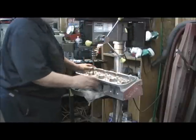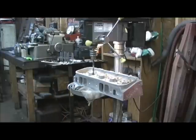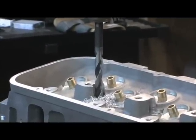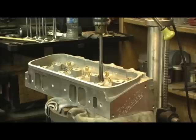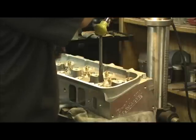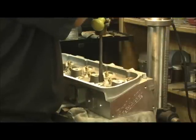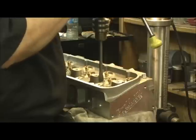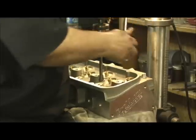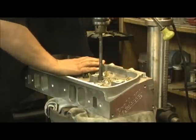Now I'm going to go ahead and drill the other hole, then come back with a core reamer and do it. I'll show you how good the fitment is, setting it up for the brass tube. Just a regular core drill — and the reamer, now that's another story. We're going to ream it to size, and like I always do, it's about a thousandths or sometimes two thousandths smaller than the tube. The holes are reamed.